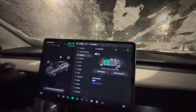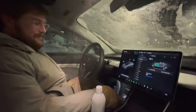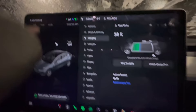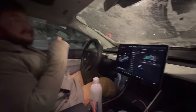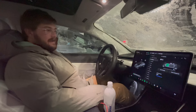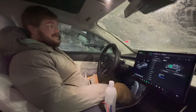So right now — wow, that was a really hard slam for a cold car. It's like a brick. We have heated seats on, no climate though. We're getting five kilowatts right now from the charger, but you can see we're getting zero miles per hour added — that means nothing is going into the battery pack. Five kilowatts is going to battery heating. The way the Model 3 heats the battery pack is really neat — it actually runs the front and rear motor as waste heat, running them inefficiently, creating up to seven kilowatts, about three and a half kilowatts each, as waste heat that goes into the battery pack. We've plugged in at 35% state of charge and we're only getting five kilowatts. Nothing is going into the battery — it hasn't even started to charge yet.